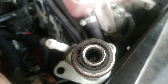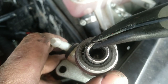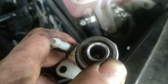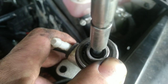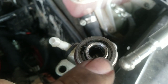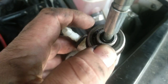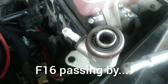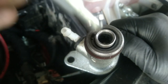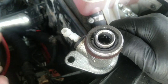What did happen on this primary pump? It is very strange. On the center here we have the cylinder that works to push the fluid, okay? And inside here you have the shaft. This shaft, as it seems, is held on the inside by a clip or something that broke. It is very strange because the forces that are exerted here are only on the downwards position, like this. The thing that broke inside there only prevents the shaft from coming out, so no forces are applied there.